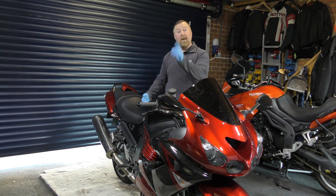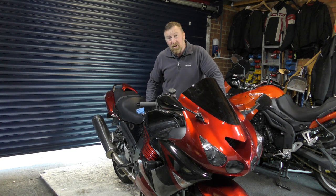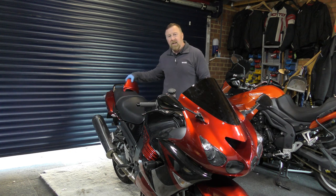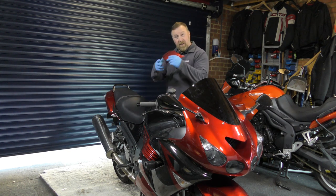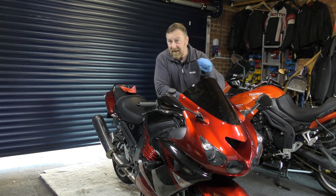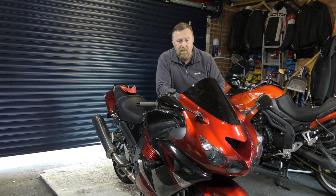I'm going to do a full service on it - the tank will come up anyway. Battery on charge, which always makes sense while you're there. This bike sat for four years and the battery is still good, which is a testament to quality batteries. I'll be changing the back a little bit, taking the rack off and putting a solid one on. All the panels off, we'll look at all the brackets, clean and paint them. General service: oil filter, air filter, oil, spark plugs, and clean everything I can. Changing the bulbs to LEDs - it'll make the whole bike look a lot newer and nicer.